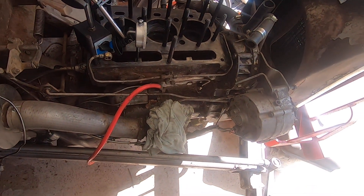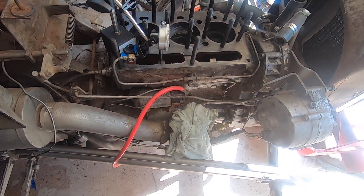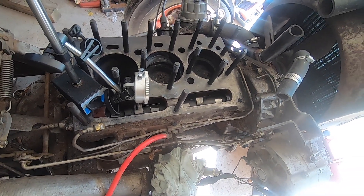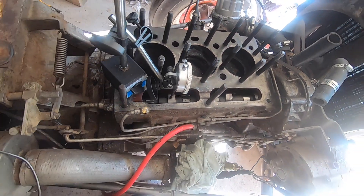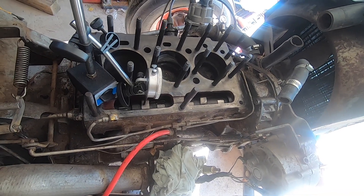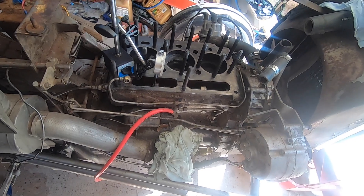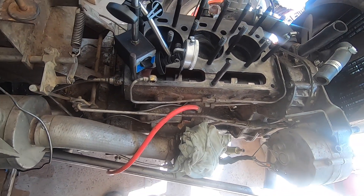I went through the manual and there are a couple things I need to check when I get this thing back together - confirm valve timing, stuff like that. Another reason I think it could be somewhat fuel related is that there are a lot of things that can go wrong with a gas engine when the tank is mounted right above all your heat. You're generating all this heat and it'll boil that gas. Even though this one has a heat shield, it doesn't boil at normal operating temperatures, but it still seems like a really bad place to put a gas tank.